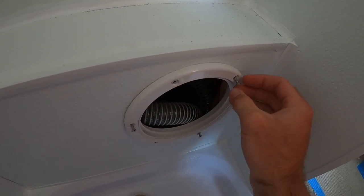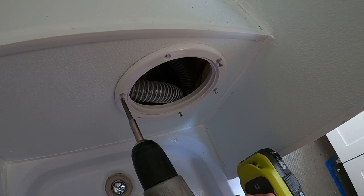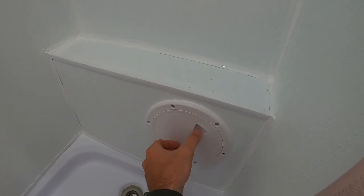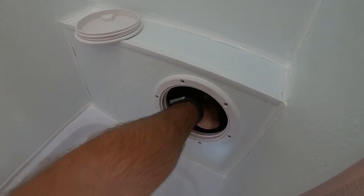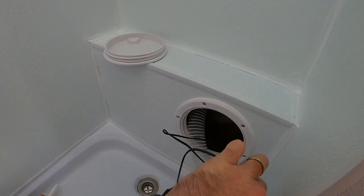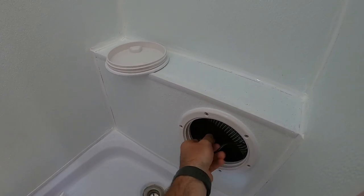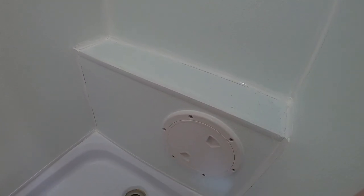I pushed this on with the Butyl tape and it's nice and snug — the screws are actually sticking because the Butyl tape's there. Now I'm just going to screw in to secure this into place using number 8, 3/4 inch stainless steel screws. Here's the finished product: with the silicone wrapped around it and all the screws in place, I just unspin this and I have access to the Nature's Head hose and the electrical wire to plug in the toilet. When we're ready to shower, instead of leaving this exposed and getting wet, just tuck that back in there, spin this back on, and we're waterproof.